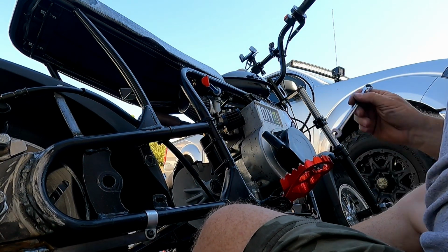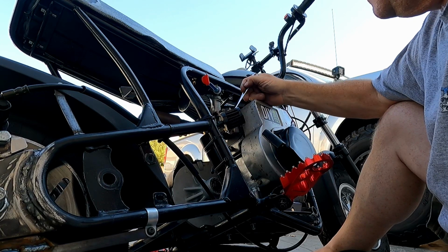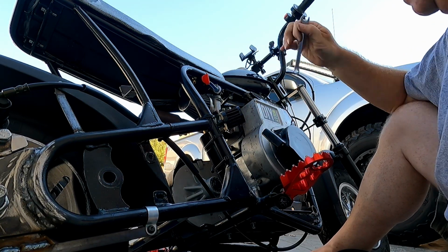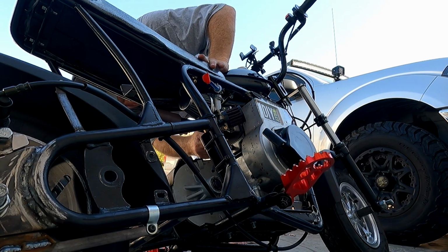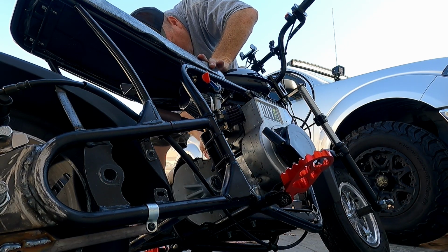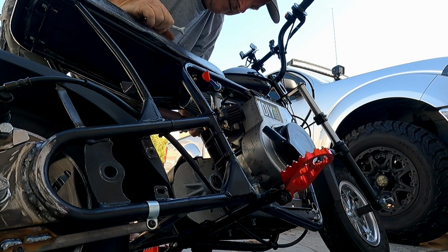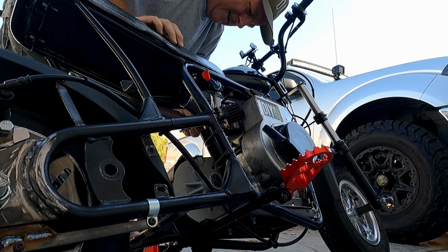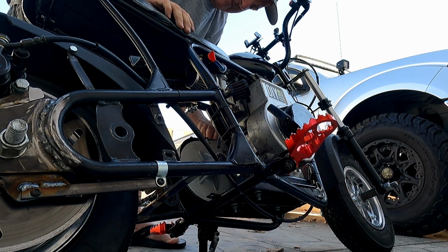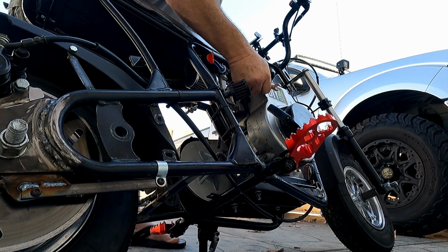So the carburetor is kind of a mix. The Briggs has 7/16 bolts, and the carburetor's got 10mm. We'll get this off. Now I need to do the other side a little bit as well. So let me go do that. This is going to be so cool. I'm excited to have this manifold. Even though I liked how this Tecumseh manifold worked, it got my PZ20 bolted up, but yeah, it will be much better with that manifold.